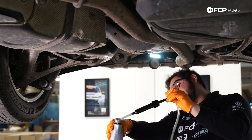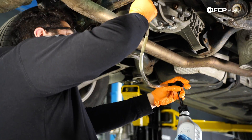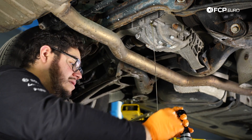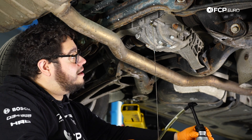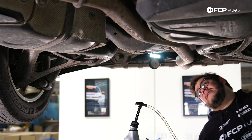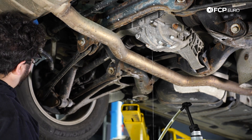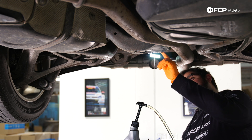We've pretty much maxed out the first liter. We're going to go ahead and set up with the second one. We are at about 1.3 to 1.4 liters now. While this drips out a little bit, I'm going to go ahead and spin the back wheels a bit, just to get any potential air bubbles out of there and let the gears suck up the fluid. She's slowing down to a dribble — we're going to give it just a few more seconds.